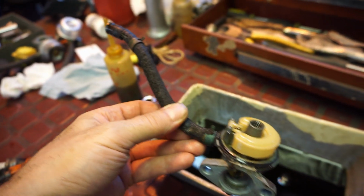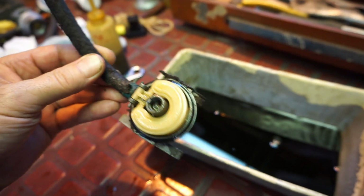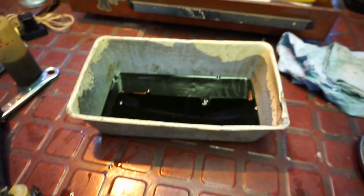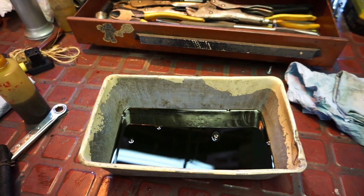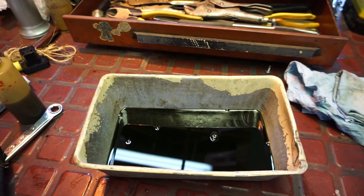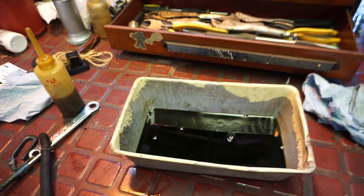Look at the carburetor. Now the fuel line is no good, but the carburetor is just dirty, and it has suffered no damage as a result. By the way, guys, if you're going to store something for a long time, you can take stabilizer and gas and a bit of oil and two-stroke, and maybe even concentrate it, and run it into the motor and let it stall.